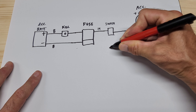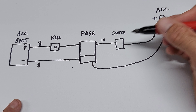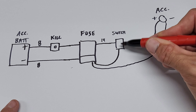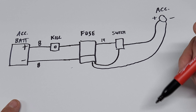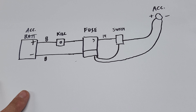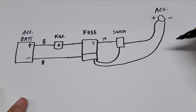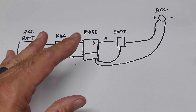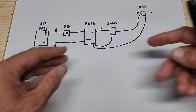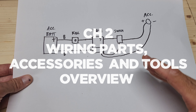From the switch you have an accessory — it could be a bilge pump, a light, whatever. Say it's an LED light strip — it's got a positive and negative. The positive on the accessory feeds into the back of the switch, and the negative ties into the negative bus terminal. There's also a negative on the back of the switch — the third wire — which also goes to the negative bus terminal. Normally when I'm running six or eight switches, I'll jump all the negatives on the back. For a bilge pump, put a 5 or 6-amp fuse. That's how I do it.